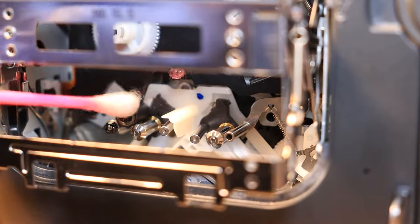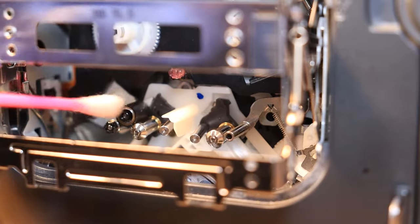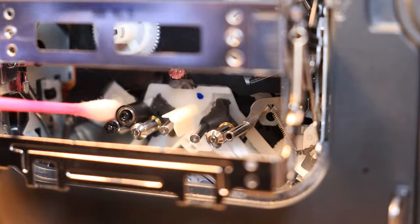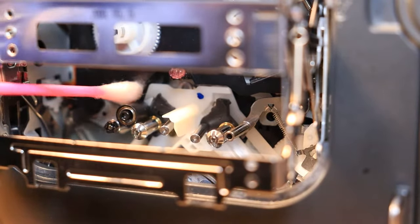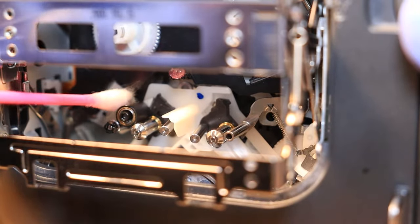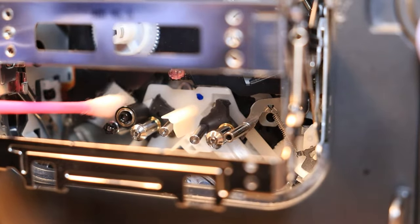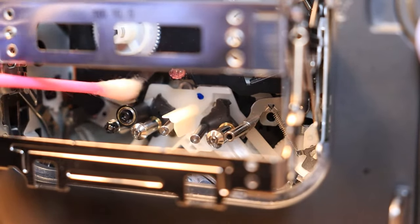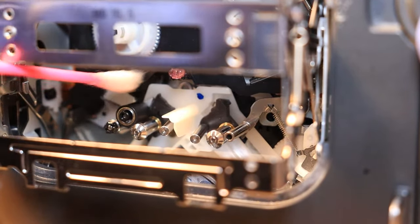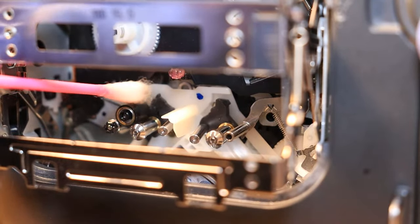If you use a lot of different brands of tapes, all tapes have their own kinds of lubrications on the tape. Some are wet, some are dry. When they all start mixing together on the same tape heads, that's when it starts to get gunked up and makes your footage look all gross and yucky looking. If you want to switch tapes, just make sure you kind of keep the same company. That way you kind of have a consistent lubrication on the tapes. And that way you're not mixing the lubrications wet and dry and all that kind of fun stuff.